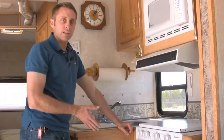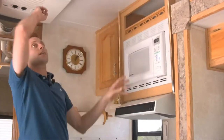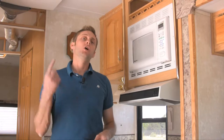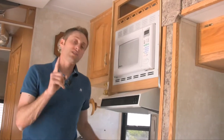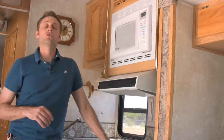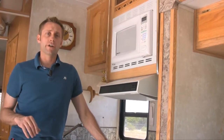Your TV, microwave, and air conditioning have to have power — they don't run off the batteries. That means you either have to be plugged into park cable or you're running the generator. If one of those things is working, you can use your microwave, TV, and AC. And yes, as you're driving, you're welcome to use your generator — it just uses fuel from the unit. So you can have the TV on or use the microwave while driving as long as the generator is on.